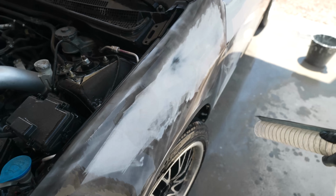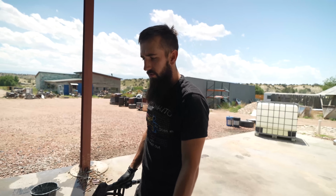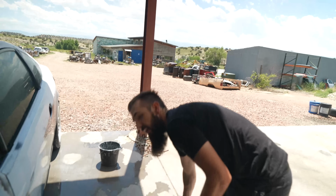And you pretty much just do that over the whole car, over and over again. This is the first time I've ever tried it with the 600. We've never really finished a car with 600 before we spray. It's usually always 400. So I'm curious to see how it's gonna lay out once it's all sprayed and done, and 3 weeks later, if it shrinks or if it doesn't, or if it's just laser straight. Now we just give ourselves more work to do on every car.